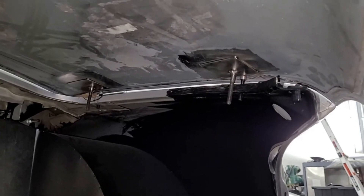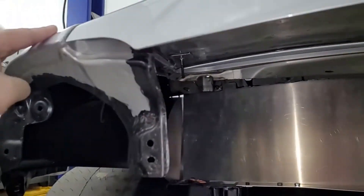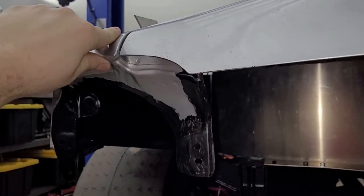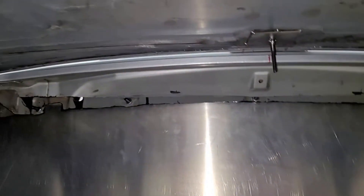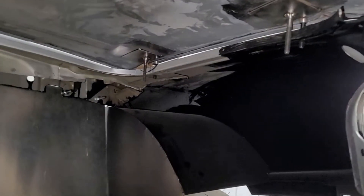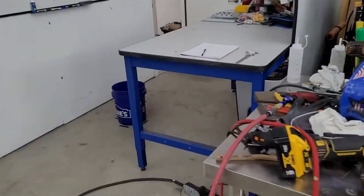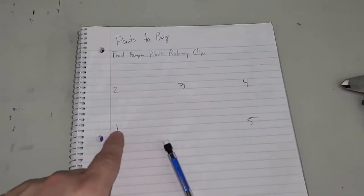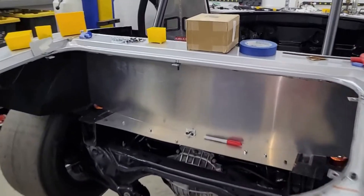Not intentional, but in theory the trunk lid will also be slightly structural - my bodywork back here was a little floppy, probably didn't show up well on video. When the trunk lid is bolted, all this will become structural, at least a tiny bit. Here's what we're going to do: pop this hole in, get our measurements, and build our plates. Probably going to use eighth-inch thick steel plate for strength and rigidity. We've got our paper with the five marks, got our caliper, so we're going to grab our measurements and get to building.